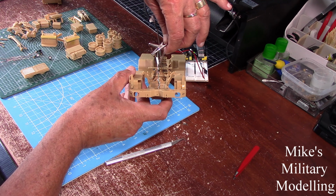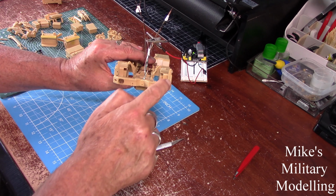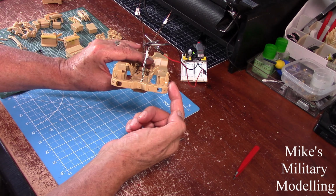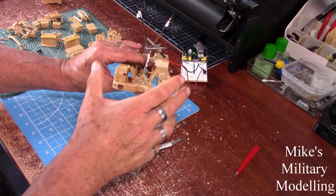and when I set it all up, I'll set them up as hazard lights, and they will be all the way around the truck so that they will flash independently of the lights being on. I'm just making life more complicated for myself. Again, tiny little, you cannot buy the LEDs small enough, so you've got to buy the smallest you can get and then remanufacture them so that it will fit into that sort of space. When the glass goes on there and it's painted, there won't be any light spill from the sides, and it will be an orange lens on the front.